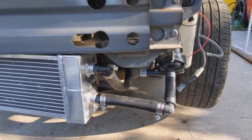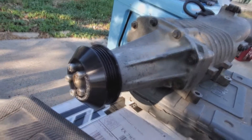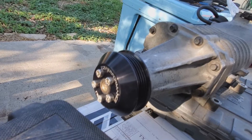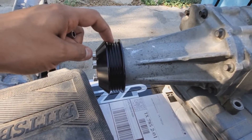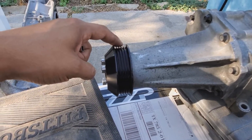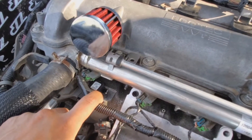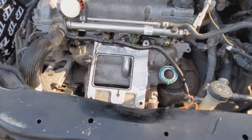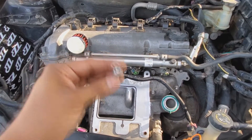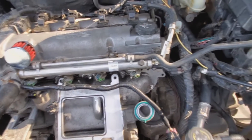If you have any questions about how to route the heat exchanger, message me or chime in the comments and I'll gladly help you out. Talking about the supercharger — I went ahead and put on the ZZP 3.1 pulley already, because it is a five-rib belt system for the 2.2s and 2.4s, and swapped out the pulley with the new hub and pulley they supply in the kit. What I'm going to take care of now is tighten down the MAP sensor with a 10 millimeter bolt, then install the supercharger on top and tighten it down with the hex bolts that ZZP supplies, and that'll be secured.